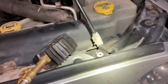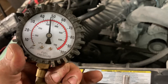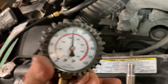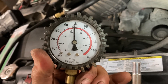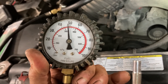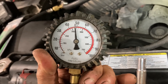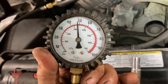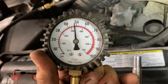You can see it goes to the fuel pressure gauge. The spec is 58 PSI, plus or minus 2 PSI — again, that's for a 2007 to 2011 Jeep Wrangler with a 3.8 liter. I don't have the engine running now because I'm troubleshooting a random misfire, but in the case of this engine it was rock steady at about 58 to 59 PSI, so that's perfect. I'd say specs should be between 56 and 60 PSI — that would be ideal.